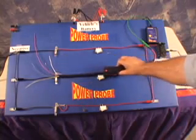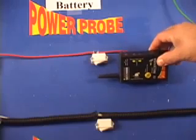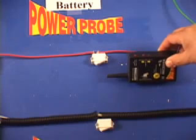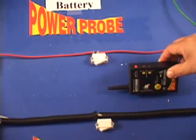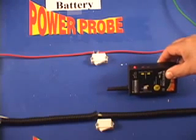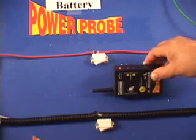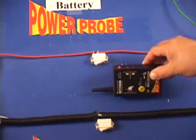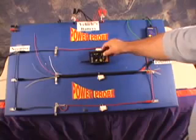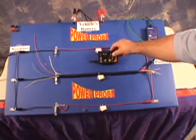Let's do something different now. Slowly lower the receiver onto the main circuit that has the signal lead connected to it. As you can see, the receiver detects the open circuit signal about 2 inches away. Now, keep the receiver at this distance and then trace the circuit. It's here at the open switch where we lose the signal. Holding the smart receiver at a constant distance from the transmitting circuit while you're tracing is the recommended way to keep you on track, as well as knowing a weak signal from a strong signal.